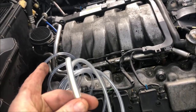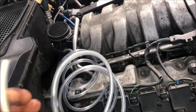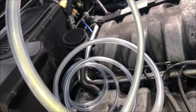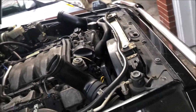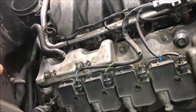Okay, before ramming anything down in there, I've just taken a piece of motorcycle fuel line and put it over top of that hose there. You can see it down there, right here, that clear line. And I'm just gonna simply blow through it. And yeah, it's blowing straight through, so that's not the issue. You can suck if you wanna taste some fuel vapors. But that's not the issue,